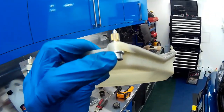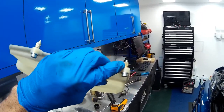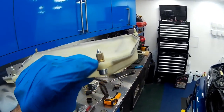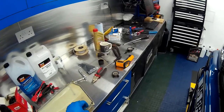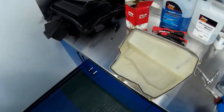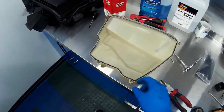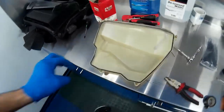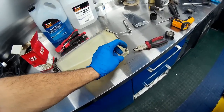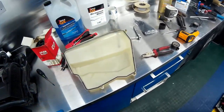The reason the bolt seizes is because of dissimilar metals — the bolts look like they could be steel but are actually aluminium, so over the years dissimilar metals cause corrosion. It's not a difficult problem to sort out: once you've done that, use a pair of pliers on the bushing then unbolt it using the hex key. When you refit, put a little drop of super glue on each bushing, and when you refit the bolt back into the lid put a drop of grease on each bolt thread to stop it seizing again — then you'll never have any issues going into the ECU compartment again.